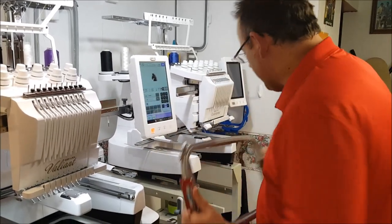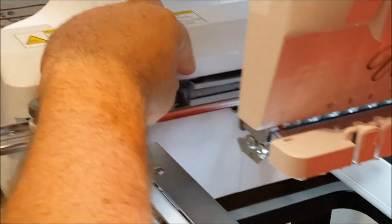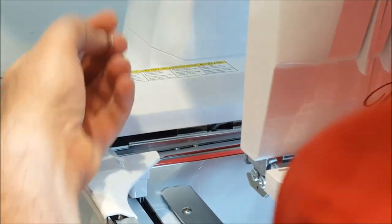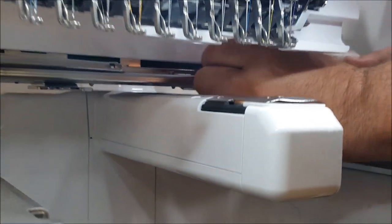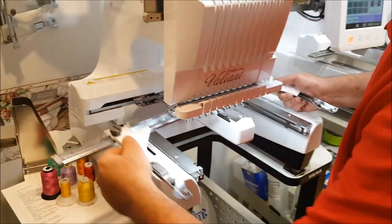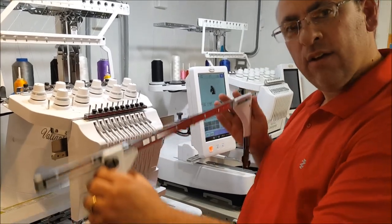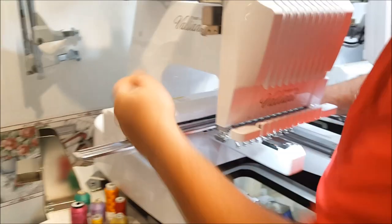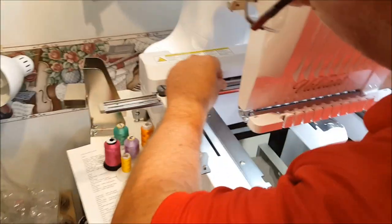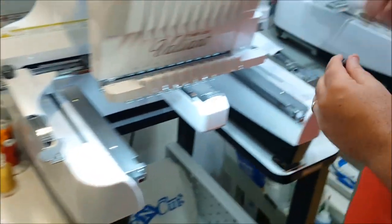I don't have a bigger hoop. So if you ever get this message — and I've already loosened these up quite a bit — what you need to do, or what worked for me — again, no sponsor, these are just tips and tricks I've learned — is remove the two screws that hold the A-arm in. Take it off. There's a little sensor in there somewhere — you can't see it, it's buried in there. Somehow that has gotten off. So remove your A-frame from the machine, slide it back in where it needs to go, put your two screws back in, make sure they're nice and snugged in, and that should reset and get rid of your error message.